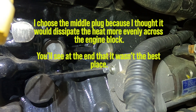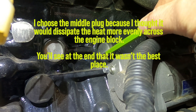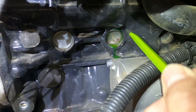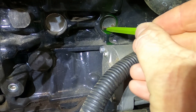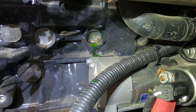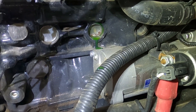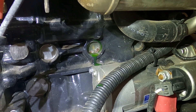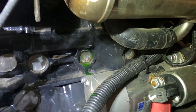Let's get the punch and see if we can knock it out. The trick to these is to try to knock them right on the edge. What I did is tap on the bottom — the plug starts rotating out. You'll lose some coolant; it's not the end of the world. I've got the bucket underneath trying to catch as much as I can. There's no good way to get the camera in there and hit it at the same time, so I'll try to get it out a little farther and get the camera back on it so you can see how it's done.